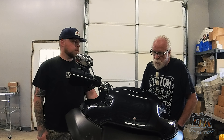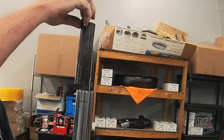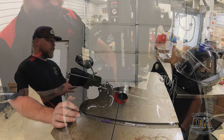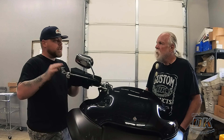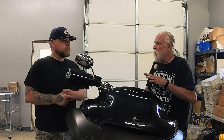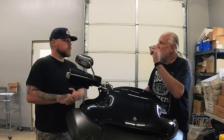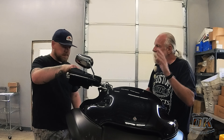The next question is: what amount should I cut on my preload spacer? Nathan elected to cut some length off of his spacer for a slightly more plush ride quality. If you're doing aftermarket springs, just follow the instructions that come with them for preload spacers — they'll tell you to measure to the threads and add a specific amount. The Intimidators won't really be a factor in those measurements, but they need to be in place when you do the measurement.